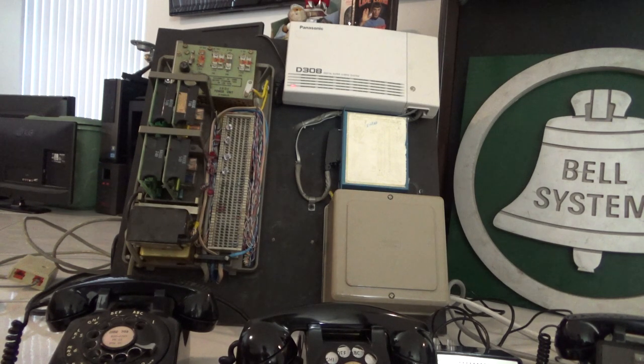On the top right is a Panasonic KX-TD308, which is a digital analog hybrid key slash PBX KSU with capability of three CO lines. With the optional station expander module installed, I have eight digital ports and eight analog ports. I'm using this Panasonic as a little central office to provide dial tone for the four CO trunks on the 1A2 key system — the 551 KSU. Extensions 21 through 24 off the Panasonic are feeding each line card on the 551, which appear on all the phones I have plugged in.